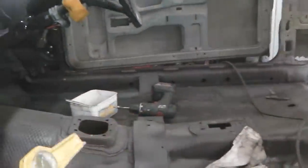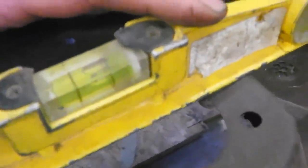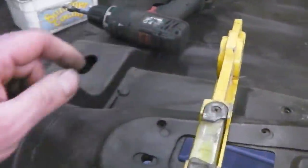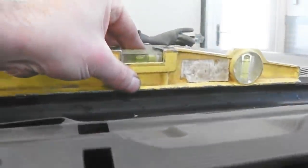And now what we do, we just check that that comes in all over, everywhere except the roof. You don't measure the roof yet. So you go, let's have a look. For example, this tunnel's never changed. Okay, so that goes across to the right a little bit. That's probably the most reliable reading. That goes across to the right a little bit. So those two are untouched. The scuttle has got a slight curve into it, but that does start to edge to the right. It's biased slightly to the right, not quite in the middle.